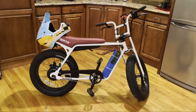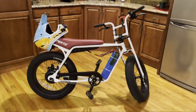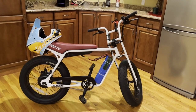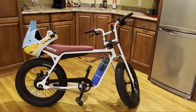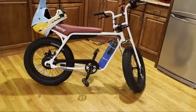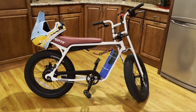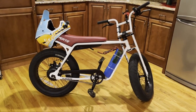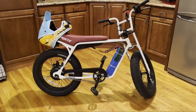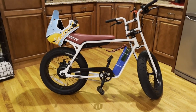The 52 volt pack that we were using is actually a Lunacycle pack, a fantastic pack. I use it for my other e-bike. It has a 50 amp continuous BMS and is made up of Samsung 30T cells. So it's a 5P pack, nothing wrong with that at all. It's just that the voltage on a hub motor is what turns the RPM into speed. So if you want to go faster, you need more voltage. That's where the 72 volt really shined in this situation.